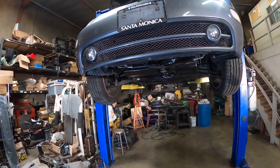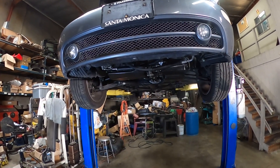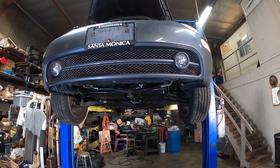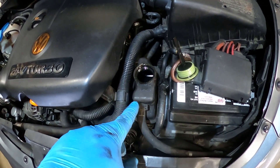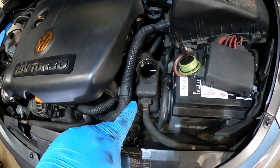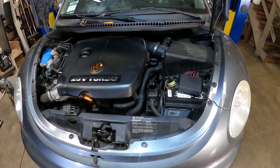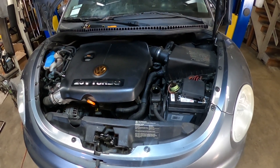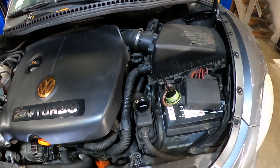I'm going to bring the car down and add power steering fluid and turn it on. I don't think I have to prime it or bleed the air because there's still oil inside, so I should be good just adding oil and everything should work no problem. Before you add fluid, make sure you check the owner's manual because sometimes they require special fluid. On mine I don't need any special fluid, it's just power steering fluid. But some cars use automatic transmission fluid, other cars use synthetic power steering fluid. So check your manual and make sure you put the right fluid.